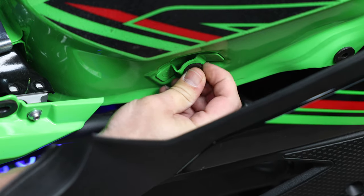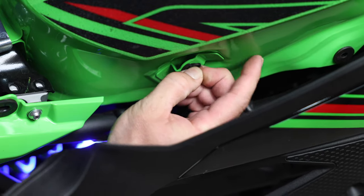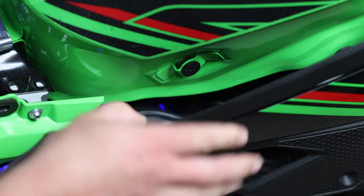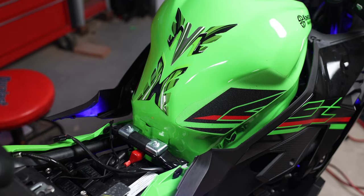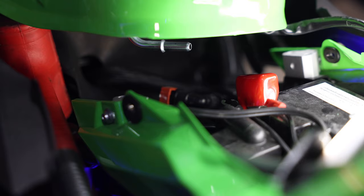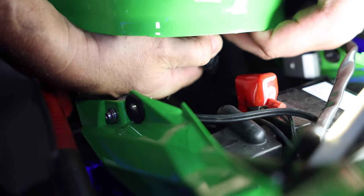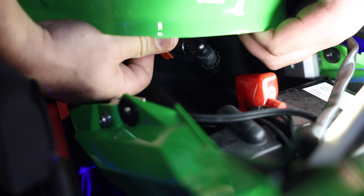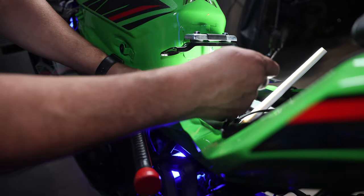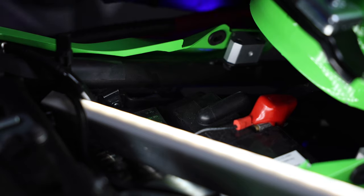Something I've found very annoying that's happened multiple times: these little rubber pieces on the fuel tank just kind of pop out of place. Definitely recommend you look at these and make sure they're in the right spot. I'm going to pull this out so you can see how it's supposed to sit and weasel it back in place — it's off on both sides of my fuel tank. Same thing happened on the left side last time, so it is definitely annoying to peel all this back in. We also have this little piece covering our fuel line, which kept our fuel from leaking. All we have to do is slide this line back on, feel it seat all the way, then push the red pin down and we're back on. Route the fuel connector down the side so we don't mess it up putting the fuel tank back down.